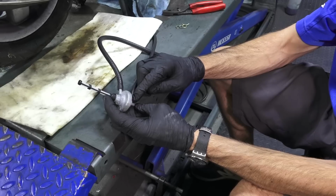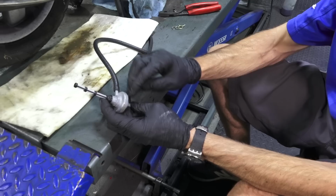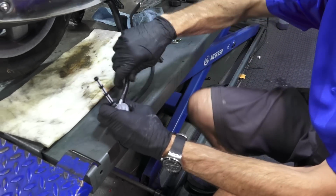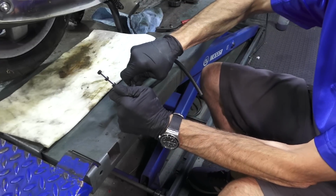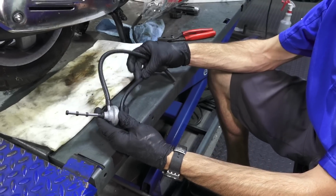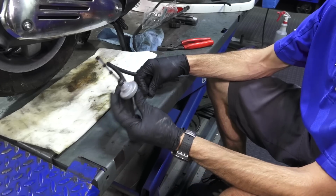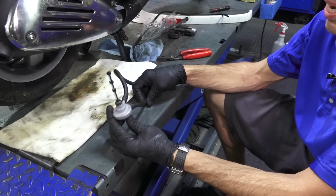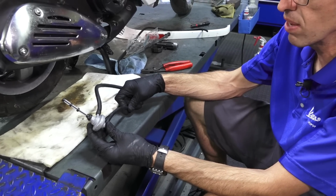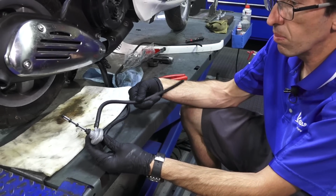And when there's a vacuum signal from the motor started, so when it pulls vacuum on this, it opens the diaphragm and allows the fuel to flow through the fuel line into the carburetor. But once the scooter is turned off or it falls over and the motor stalls out, the vacuum is no longer produced by the engine and turns the fuel off. And oftentimes I see these fail by either leaking fuel into the vacuum line, causes the engine to run really rich, or it no longer flows fuel where the motor just won't run.